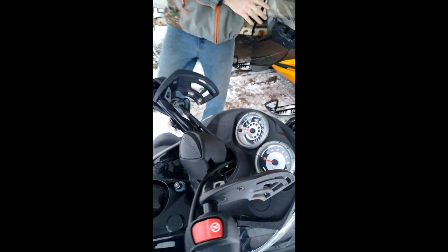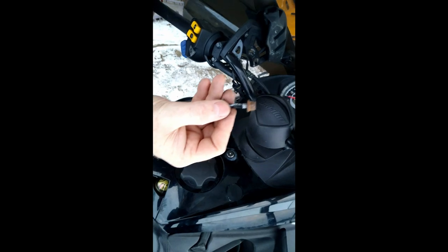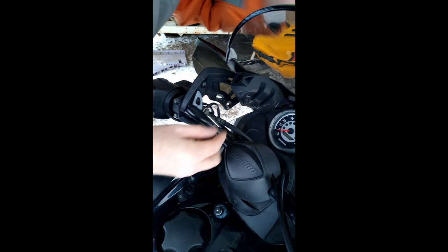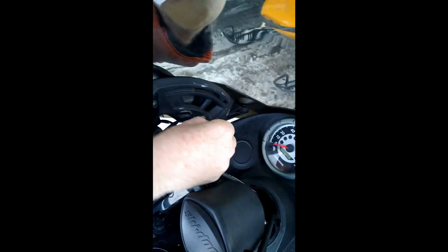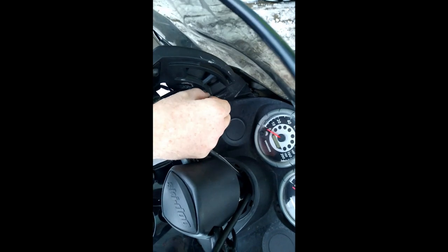And next step, look on the windshield. On the windshield, when I took it off the first time, I actually used some anti-seize on these bolts because they were rusted and definitely seized. Now they have a square carriage bolt style on plastic, mind you. It's called like a fender washer. Yeah, and you don't want to have that seizing up. It's just not a good thing.